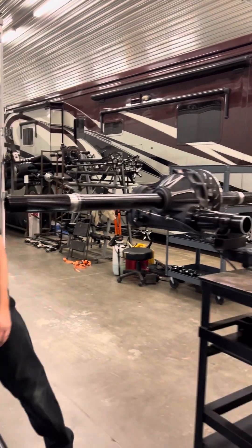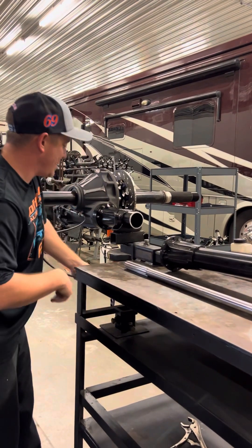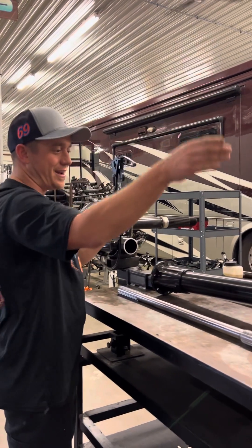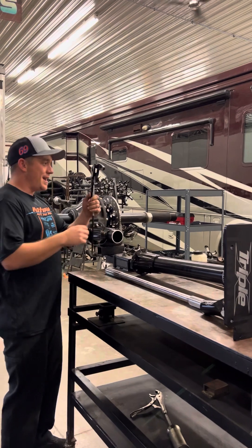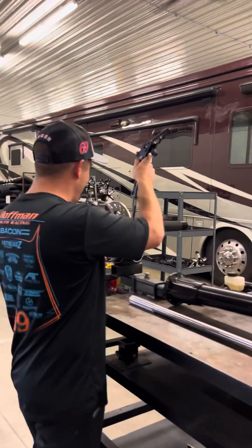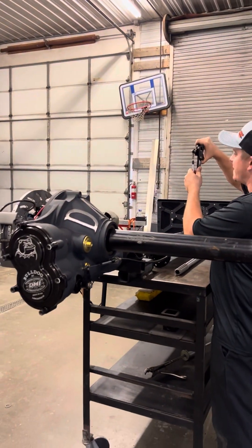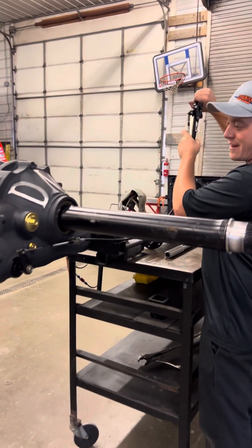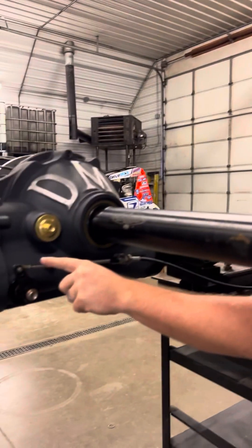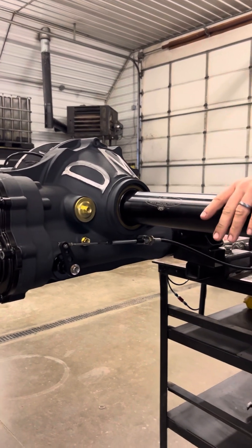How do you stop? How do you go? I get that question a lot from even non-casual fans. This is our shifter that's inside our car — it would be up around right here, easily reached by our right hand. To take it out of gear, you pull it up. There's a lever on here that moves, and this cable is connected to that. It moves a shifter linkage on the inside — put it in gear, take it out of gear. When it's out of gear, the engine can still run, the drive shaft's still spinning, the lower shaft's still spinning, but it disengages in here so it's not turning the gears, not turning the ring and pinion, not turning the axle.